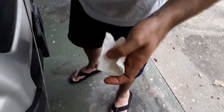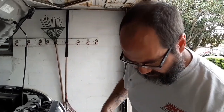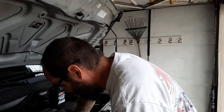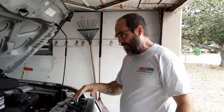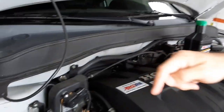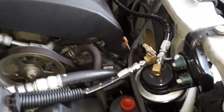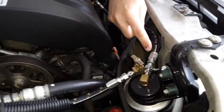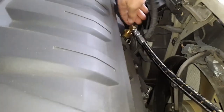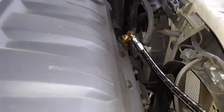For those of you who didn't see it, I'd highly recommend going back and watching those videos. Basically, it takes a little bit of the engine oil at a time, passes it through a super-fine two-micron filter that's 98.7% efficient, and then returns it to the oil cap right here, which has a swivel fitting. I'm going to back that out and then start the engine.